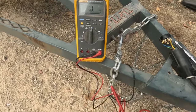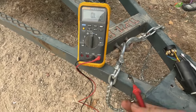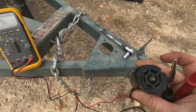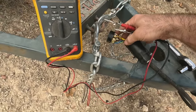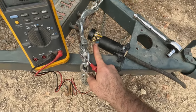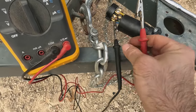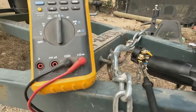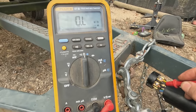I've got my meter here. I'm not going to test any amperages right now — I'm going to use the ohm setting because I think I've got a loose connection somewhere. Looking at this connector, I've figured out which wires are for brake and ground. This blue wire here is usually standard — most of them use blue for your brake controller. I'm going to hook that on there, make sure I'm not touching ground or the frame, and this is my ground wire. So I'm on my ground and on my brakes, and I'm not getting anything.